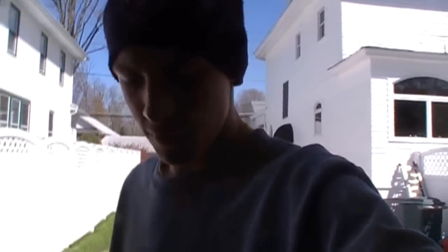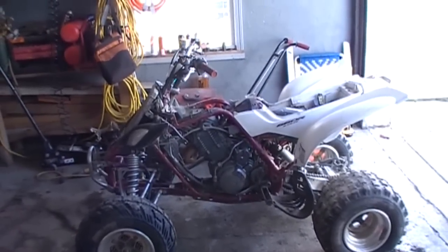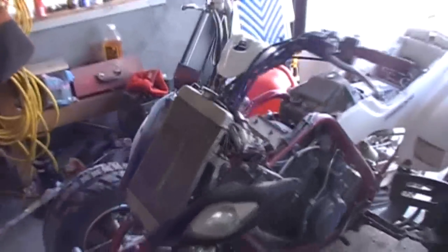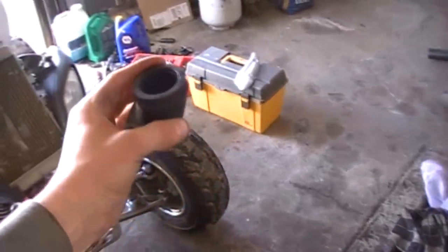You're probably wondering why this thing's all apart again. Well, the boot — the problem I had before — that rubber cement didn't work too good. It worked for about two weeks flawlessly, until I was finally riding it and a big backfire happened. I said, 'that boot must be ripped again.' After that, the thing stalled out on me when it was just idling — same thing that happened last time when the boot was open. It would just kill itself when idling.